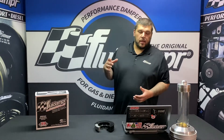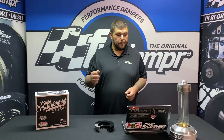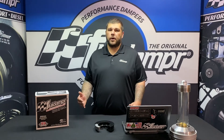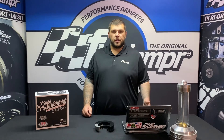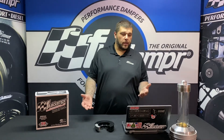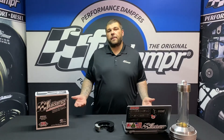The first question is kind of a two-parter: does Fluid Damper require a warm-up period? The answer is nope. The silicone fluid is stable from negative 30 up to 300 degrees Fahrenheit, so it's pretty stable even in the coldest climates — northern Canada, Alaska, anywhere with subzero temperatures. It doesn't affect it, so the answer is no.